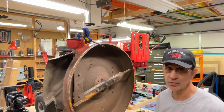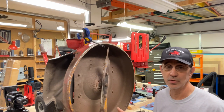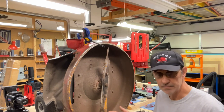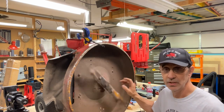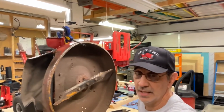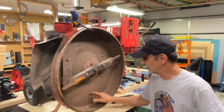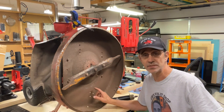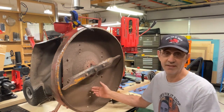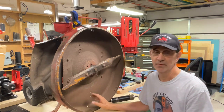What on here do I need to grease or oil? Nothing. There's nothing on here. You have your spindle, you have an idler pulley, and on some machines — I think it's mostly the European machines — I've had a lot of questions: what are these three holes for? That's for the extra idler pulley that the European machines have on them, and some other machines they sell in this country. Very few.